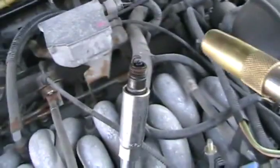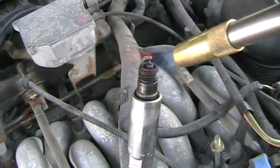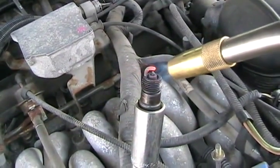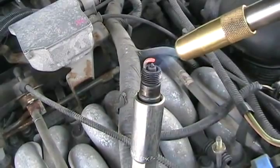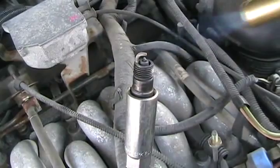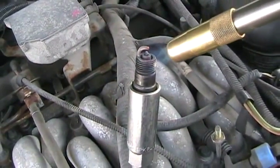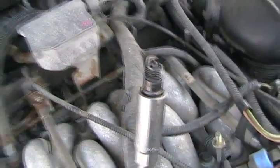This is how I do it. I very rarely buy a new spark plug or anything, unless it's all worn. This car's got some platinum spark plugs in it. The trick is you heat it till the center electrode turns nice and bright red hot. The hottest part of your flame is just where the small part of the blue tips are near the bottom, just at the tip of those — not back here and not too far in, about right there. That's the hottest. Now if it was darker out you'd be able to see that everything is red now. So we're all set for installation.